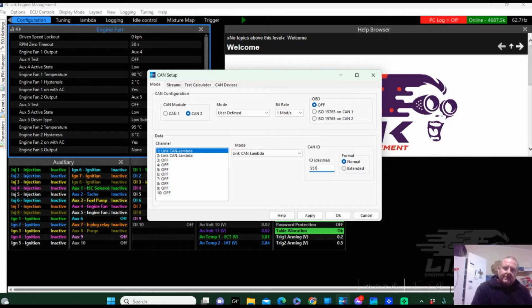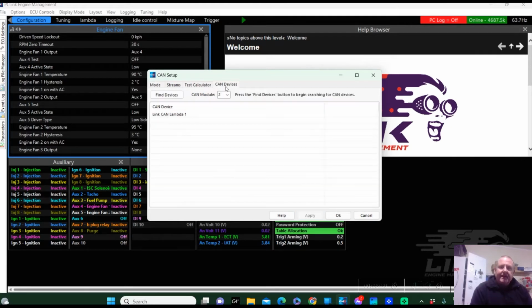It's kind of funny because in the IDs, 1 is a 0, and then 2 is a 1, and then 3 is a 2. I'm not sure who thought of that. We could have just started at CAN ID 951 for the first device and 952 for the second device, but that's not how it works. Okay, and now we're going to go up to CAN Devices. Now I'm going to go Find Devices, and hopefully now it's going to bring up a second device.